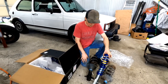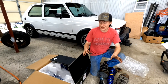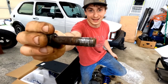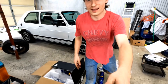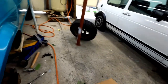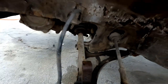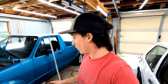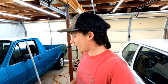We're gonna stick these on here but we're not gonna go for a drive today. First off, realizing how rusty this truck is — you guys saw me struggling with one bolt and I'm surprised we didn't snap it; the threads are totally destroyed on there, so I'm gonna have to run and get new hardware. Also, I took this off and you guys can see this brake hose is just about totally worn through — that is extremely scary. So we're not going to drive it today, but we'll finish the video another day once we get brake hoses.